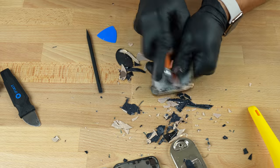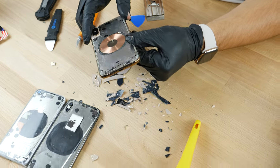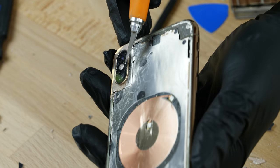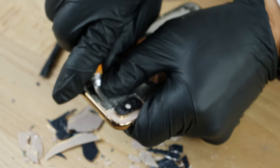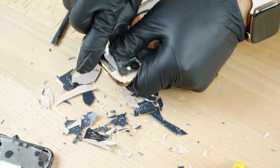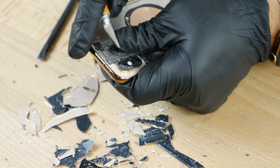All clean except for the camera. Now I'm going to try and remove all the glass from it first. Some tough stuff, seriously. I mean it cracked really easily, but the actual glass you can tell is quite tough. So last bit, and then we'll try and pry the camera apart. Be quite gentle going around the camera — you'll start to notice a crevice between the metal shell and the actual lens, and that's where we're going to pry it apart. Still got some more glass to get rid of, and this is like the toughest part. The entire back glass here is really, really glued down. Did you see the sparks? Do not do this near any hazardous or flammable materials because I keep getting sparks everywhere.